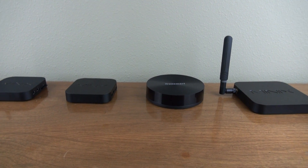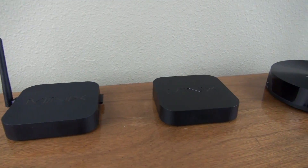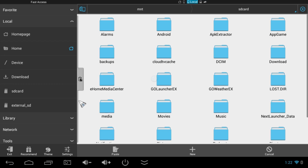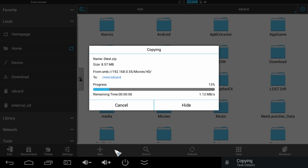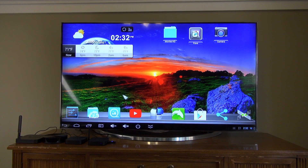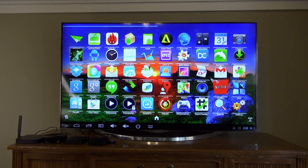Now let's compare the Wi-Fi against some of the best players out there: the X7 Mini with and without Wi-Fi antenna, the Tronsmart Vega Elite, and the Minix Neo X7. I copied the same zip file from my Windows PC over Wi-Fi to all the Android Mini PCs, timed the transfers, and compared them on a graph. The X7 Full came in first, followed by the X7 Mini with antenna, then X7 Mini without antenna, and finally the Vega. This is all 2.4 GHz as I don't have a 5 GHz router. Having the external antenna makes a pretty big difference — I can stream a 2.5 GB MKV movie across the network about 30 feet away without a problem.